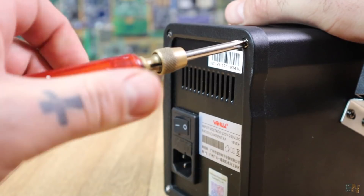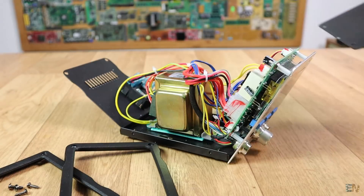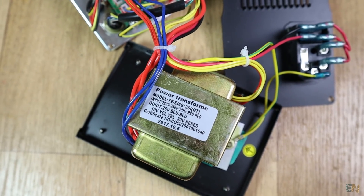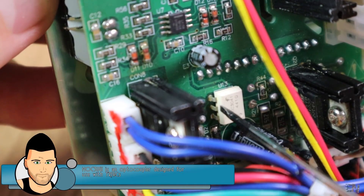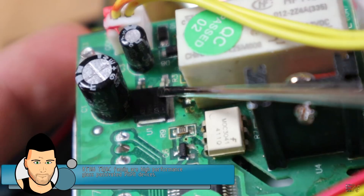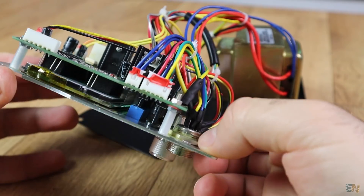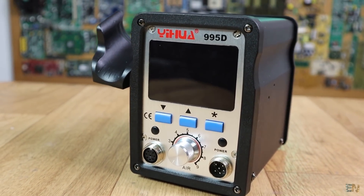Now let's open it and see what's inside. I remove a few screws and the case opens. All the wires are well insulated, which is very important. We have the main input passing through the fuse, and the earth connected to the metal plate. In the middle of the case we have the transformer screwed to the bottom plate. On the main board I can see optocouplers that separate high AC voltage from the rest of the electronics, and two triacs that control the power applied to the heating elements. There's a 5-volt voltage regulator that supplies the main chips. On the sides there are through-hole capacitors, and the rest of the small components — capacitors and resistors — are SMD.